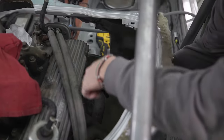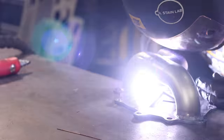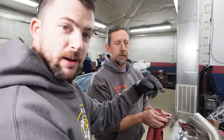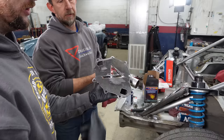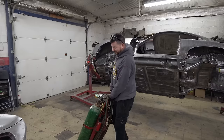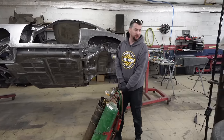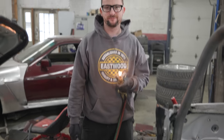There it is. Look at that. We got where our water pump could pump in right here, and then it's going to spread to the two ports in here and here to go into the block. I just have it tacked on here right now. I'll weld it once I actually confirm it fits in that space. Tony said I can use the torch as long as I'm careful and judicious. Whatever those two things mean.